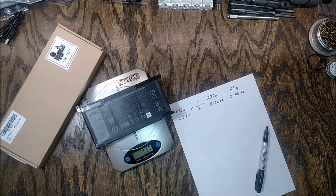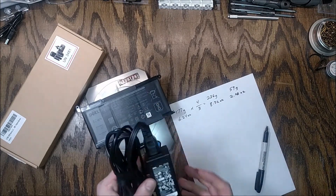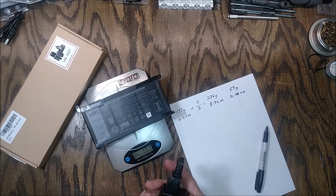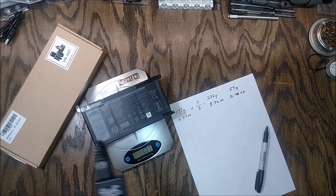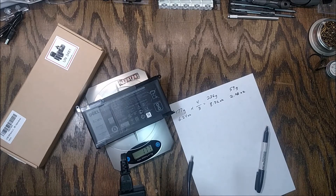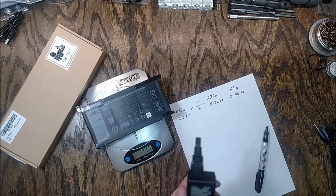The other disadvantage is a longer charge time — a bigger battery takes longer to charge. But there's something you can do about that. My original charger was a 45-watt charger, which eventually got a flaky connection in the plug, and I ended up buying a new one on Amazon. I upgraded to the 65-watt charger, which has the same plug on the end. The laptop is smart enough to understand it's got a higher wattage charger connected and can charge the battery faster. So get the higher wattage charger — it's a little bigger and heavier, but it charges a lot quicker.